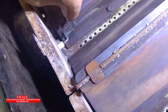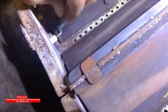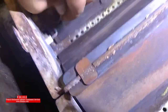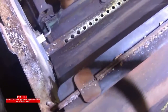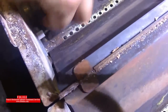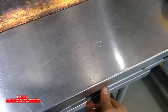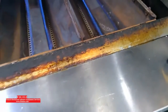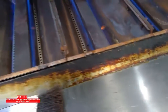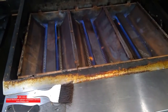I just have a paperclip here and yeah, there's a lot of stuff in there. I'm going to clean out everything I can — all the soot, everything. I'm just taking my time cleaning out all these little burner holes one by one. A little tedious work, but necessary. Firing it up now — we're getting left and right-hand side of all three burners firing up. No more gas leaks. We're all good here.